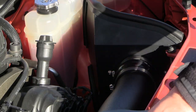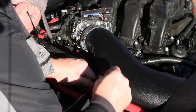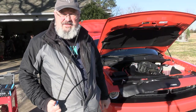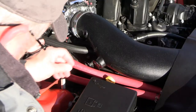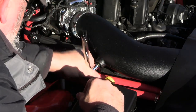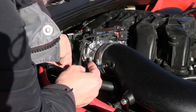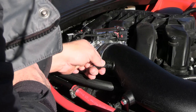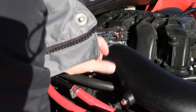You want really good tight fittings here because we don't want any air coming through or bypassing the air filter. We are good, solid. Next, we're going to double check our hump hose connections and re-tighten them. Now at this point, we're going to go ahead and reconnect this part right here. If you don't have yourself one of these tools, it makes a fine investment — you definitely need to get one of those. We'll take that air sensor and plug it back in very gently. You can extend that distance there, and I've got plenty of room. I'm going to start back here and go clockwise as I push in — and we are in.